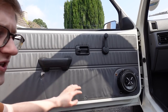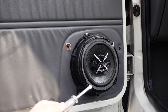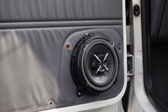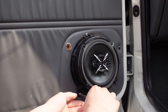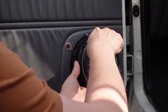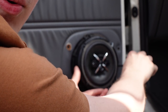Let's get to dismantling door furniture. I'll get the speaker off first, and then the window winder, the door handle, and the door pull, and then the door card should just peel straight off. This will be why this door card has come off at some point - this speaker. Now, these speakers are pretty good, and they're mounted in the original kind of Rover mounts, just with a new speaker in it. So they fit perfectly, but it's just a shame that when the door card's been put back on, they've been broken. Even that mount there is broken at the top, but the combination of the other screws and the door bin itself will hold the speaker on. Make that two of them broken - there's one screw holding this speaker on.